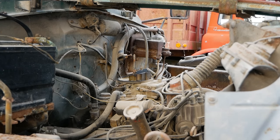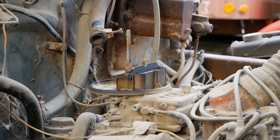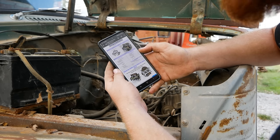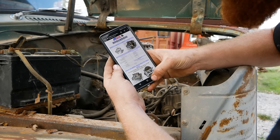Okay, all right. Now we're getting into the differences between these two videos. The other one had a remanufactured Holley. This one does not. List number 2582-1. That's a way different list number, but it looks to be the same carburetor with the mixture screws being on the back. A divorced idle circuit. Yes, the Holley 2582. This is a 64 to 70 International. Carburation.com's got some pretty good stuff if you need things like knowledge.